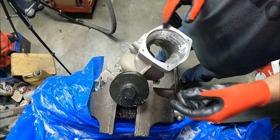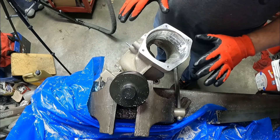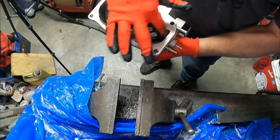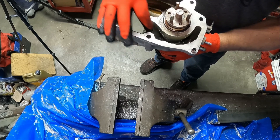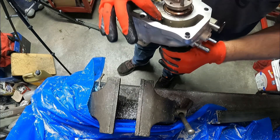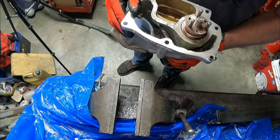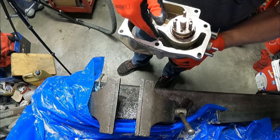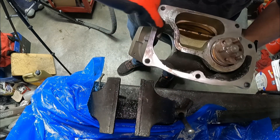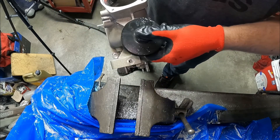I've got this opened up most of the way around - there's just a tiny ledge left. I'm going to use sanding rolls to clean that up, but first I really want to work on this side. This side gets really tight right in here and I think there's a lot of performance to be gained by opening this up. This little hump makes it difficult - I can't get too aggressive at the floor right there. I can almost shave this down to the top of where the bolt goes through, take the little hump out, and raise this floor up. I'll do the bolt boss on the inside first.